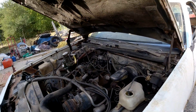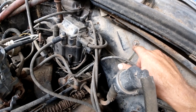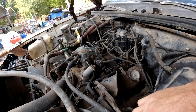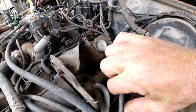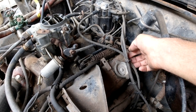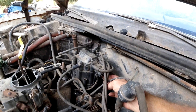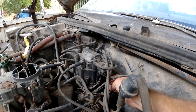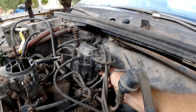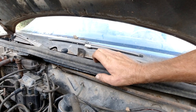You've got to undo your engine grounds, such as these here — that's just connected to the intake, you can take it off either the intake or the body. Here's your wiring harness — pull everything off. Disconnect your distributor — just this one connector here. The other one would be the tach if you've got it. Pull it out. Put all the wiring over here; I usually put it underneath the wiper to keep it out of the way.